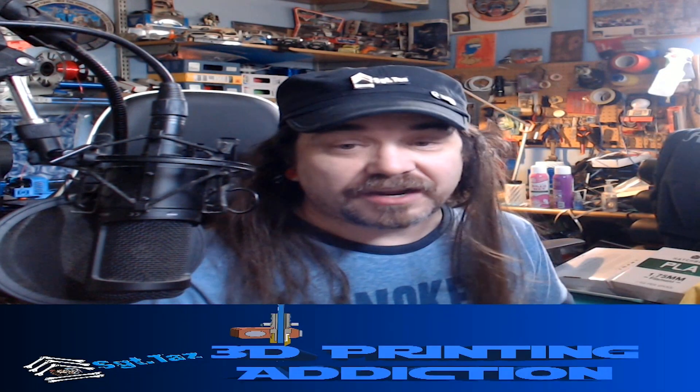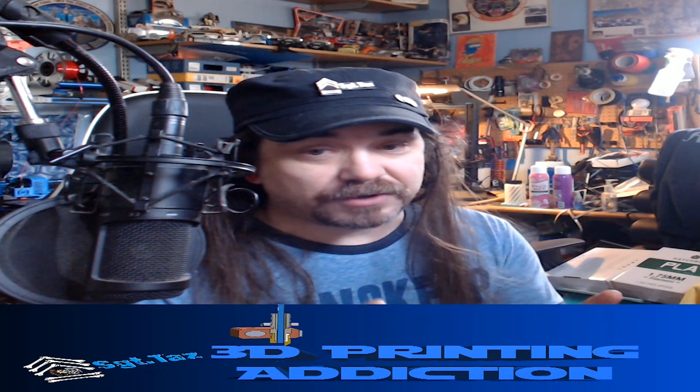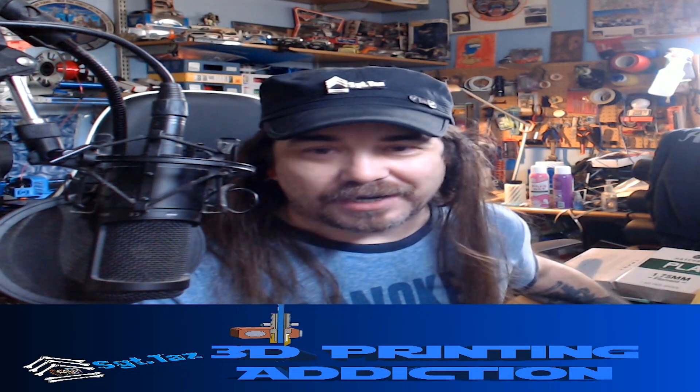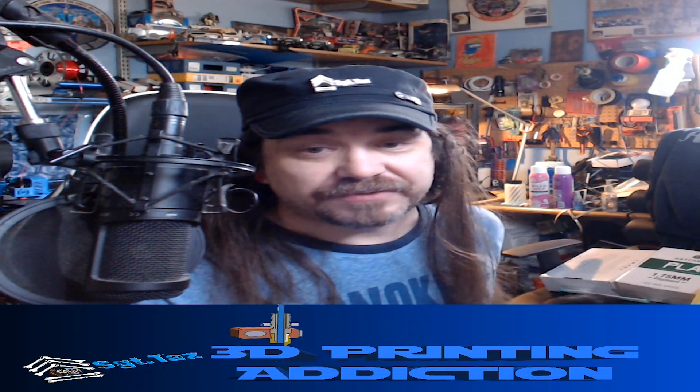Looking good! So as you can see, it's not that hard — just a bit time-consuming. Remember it's four bolts for the fan and heatsink, and be careful with the other three because it's going to come apart and you might lose the spring or tensioning lever. All else fails, take photographs as you're taking it apart to remember how it goes back together. When you have the power on, make sure those wires are clear of everything — don't touch with any metal or you'll short your board out. Other than that, it's a very simple process. Hope it helped — give me a like and subscribe, I appreciate it. See ya!